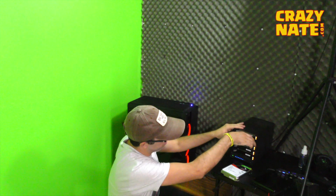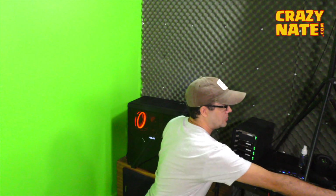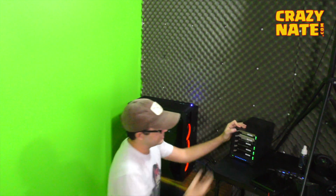I'm trying to be as gentle as I can without making jerking motions, because spinning disk hard drives, you don't want any movement, that's really hot. So now they're flashing yellow, that means, hey, hello, alarm, one of your drives failed or is missing. If you miss one more drive, you're gonna lose all your information. So we're gonna stick this big old bad boy in there and let it rebuild itself. Okay, so now it's gonna pick that up and recognize it here in a few seconds.